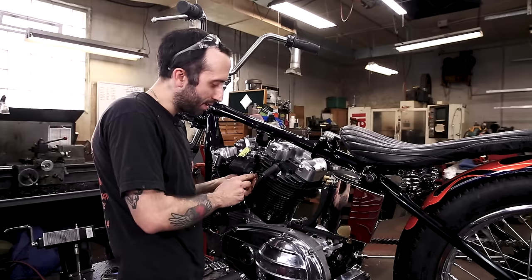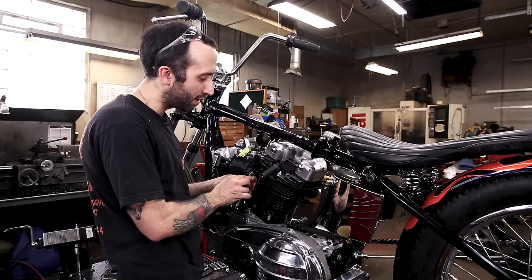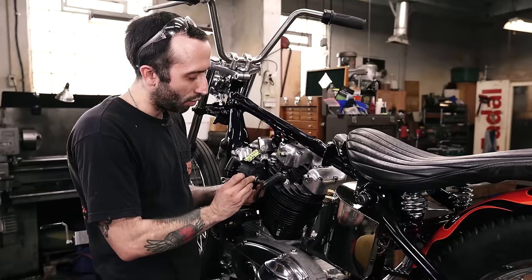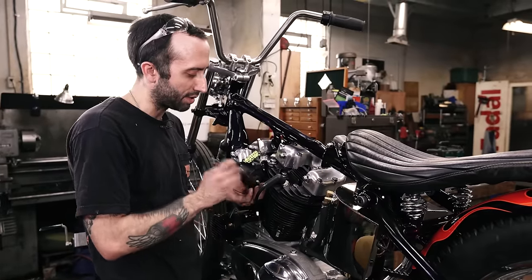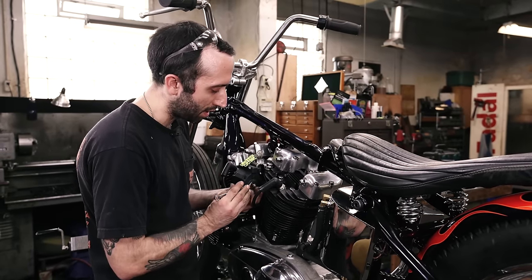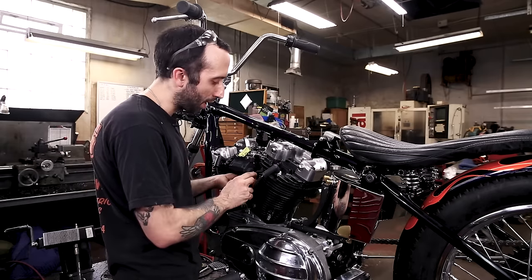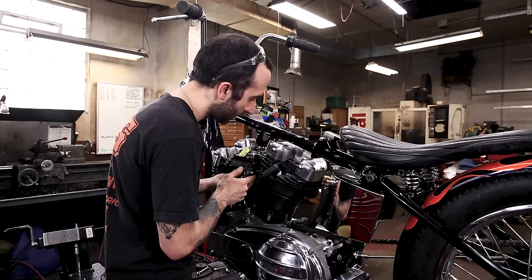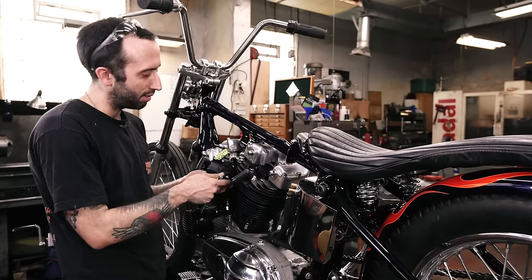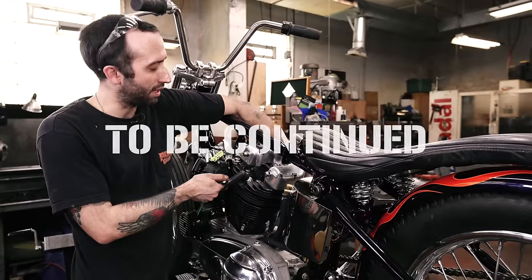And you don't have to do this like me. I keep saying this. It'd be easy if you follow the same colors as the wiring diagram, but with the cloth wires, a lot of this stuff is purely aesthetic. And I know where the wires are going and following the diagram, and I have it listed, so it'll be easy to track down later if I forget where the wires go or can't trace them on the bike. But if you're new to it, it might be easy for you to just follow a stock diagram and make the colors that same color. Or if you want to just run whatever wires so you can see them and you like the color, just make sure you write it down so you know where they go. If you have any issues later, it'll make it a lot easier for you to troubleshoot.